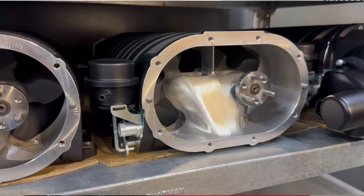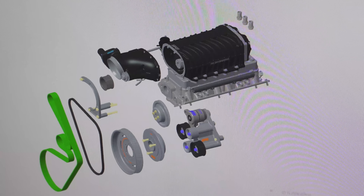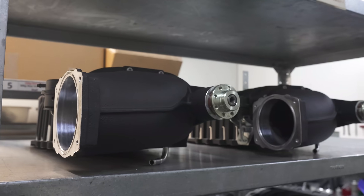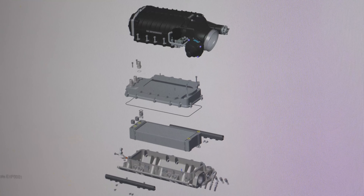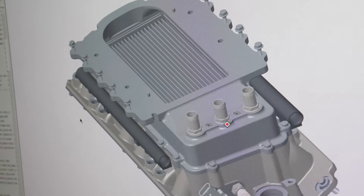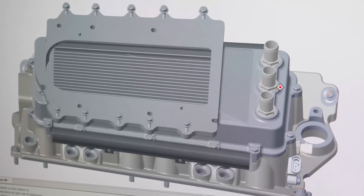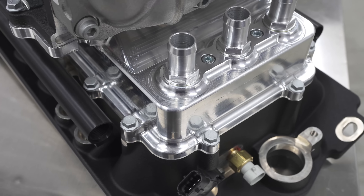As part of our modular design philosophy, for the front inlet or snouts we've got five different options available to support inlet packaging and performance goals. Our inlet manifold assembly features a cast lower with a billet upper that houses our high-density dual-pass water-to-air intercooler brick. The fittings for the intercooler are 19mm or three-quarter inch barbs, or we have the option for dash 12 AN fittings.